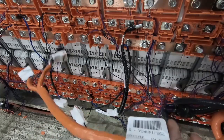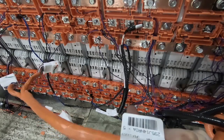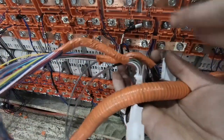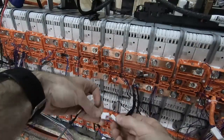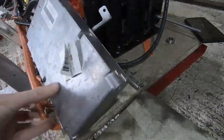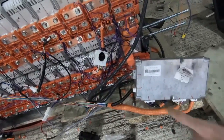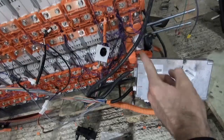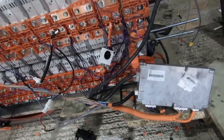This is going to be slow going. Interestingly, I found another kind of date stamp — it looks like this harness was made in June of last year at 4:30 in the afternoon. So we've got a split-up harness. Let's get this hooked up to the battery first and then we'll look at getting it plugged into the control module. Here we've got all of our BMS wiring up and running — going from the battery through into the control module, and then we've got the signal wires and power that goes out up to the main contactor.